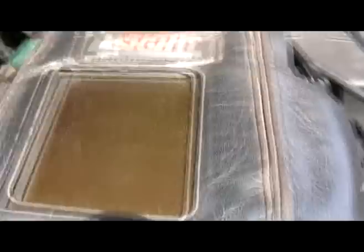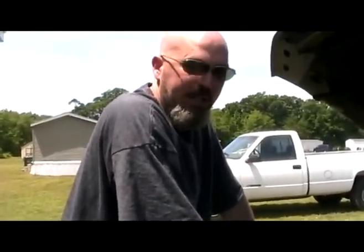It's not doing anything. This one even passes the tap test, which in extreme cases, if you can tap on that thing and then the engine either clears up or runs rough again, you've got a bad cam sensor. Mine's not doing it. Cam sensor, 20 some dollars, I'm not throwing it in there, especially if it wasn't my truck. People pay me to diagnose their vehicles, not just to guess and throw parts at it.